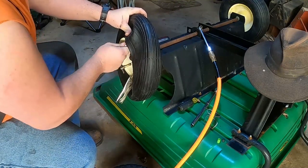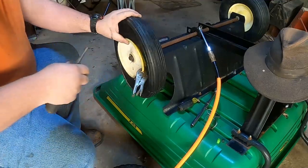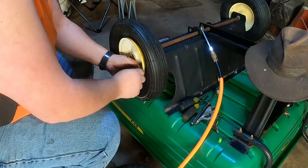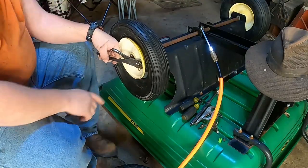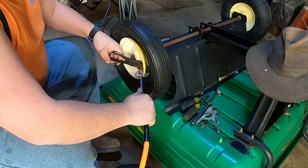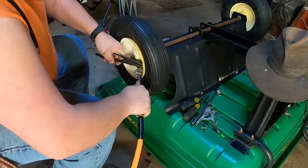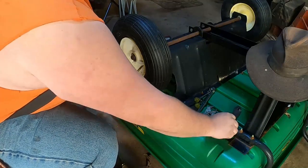Where you're doing this, be careful of the inner tube, especially if you spent 15 dollars on the thing. All right, you got it in there. Get your tool off your valve stem like before, and hold on to your stem - keep it as far out of the hole as possible because that way it will stay seated. That's how you do it with it on the trailer.